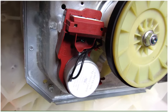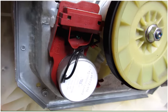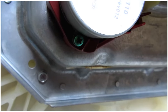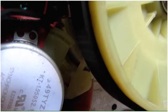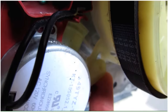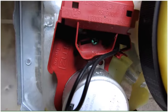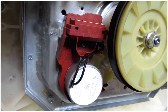With the wiring harness removed, you are now ready to take the old shift actuator off the washing machine. That is accomplished by taking out two screws — on mine they're colored green. There's one there and another one down here that needs to be removed. Note that there is a little plastic knob off the shift actuator that is looped through another plastic piece, which will be important when installing the new one. Take these two Phillips head screws off and you're ready to completely remove the old shift actuator.